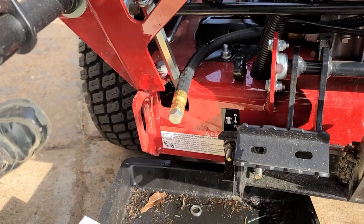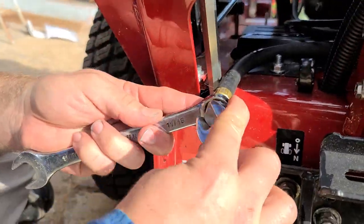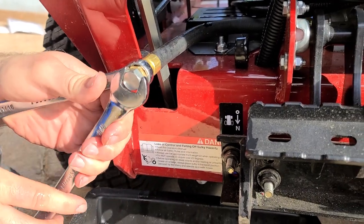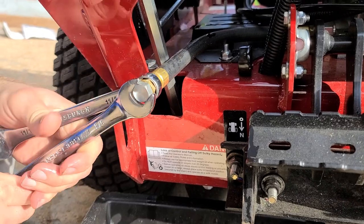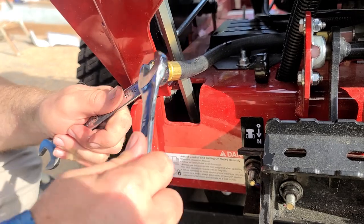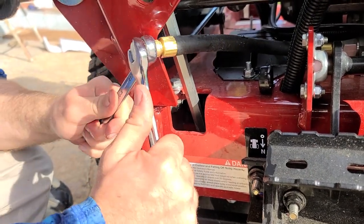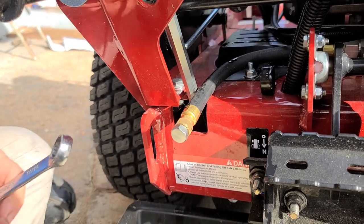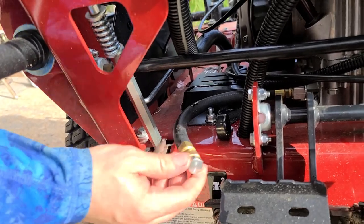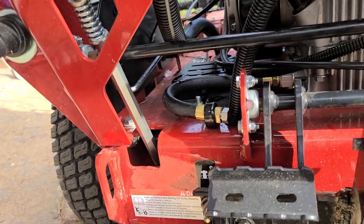Alright. Get our fingers in there real good. Loosen her up. 11/16 is the back bolt. 5/8 is the front, the actual bolt, and the other part's kind of a nut, like a nut flange fitting. Male, female, whatever you want to say. Okay. That's good. Phil, do you tuck it back into the thing? Oh, yeah. It was a tuck-in spot for this to protect it. Okay? Just like that. All right.